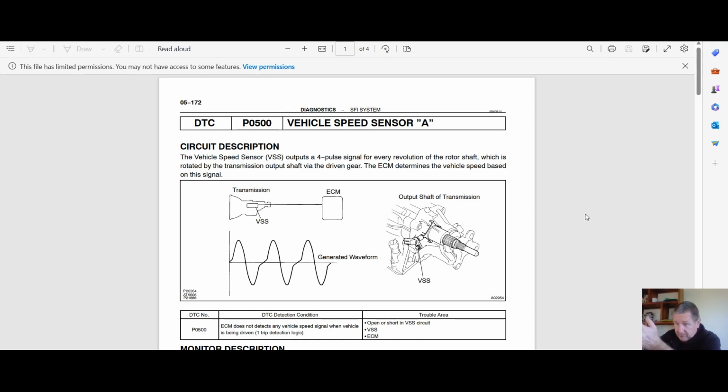I don't actually know whether there's any transfer of data through the multiplex on the 5 speeds. Okay, so that's why we're going to test it, and we're going to see what else we can make happen on that 5-speed LS430 and on the LS400s, multiplex again, on the earlier ones, on the non-VVTi 4 speeds. Pretty much it is again restricted to that transmission area and the transmission sensors. Okay, we're not talking to the ABS and that sort of stuff.